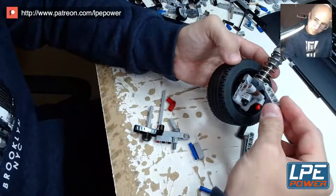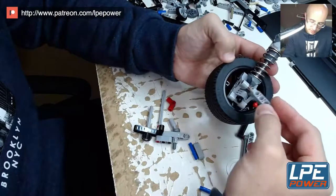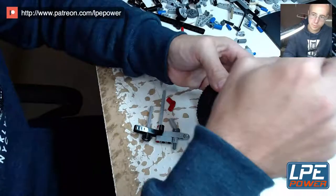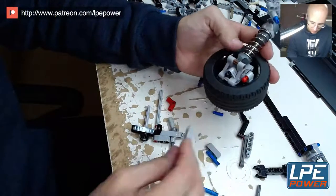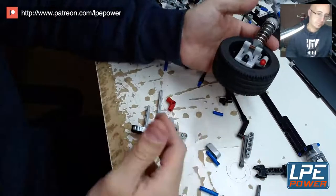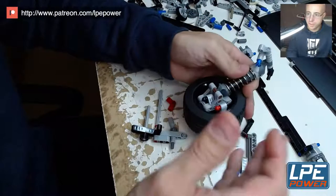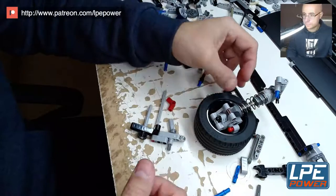Except then if we raise this, but then we destroy the whole concept of this simple wheel hub, and we have to raise this, which is gonna create problems on top. So it's not that simple, you know. It's simpler to have the anti-roll bar separate, live with slight inaccuracy in the suspension geometry, in the suspension layout, but I think we can all live with that. I hope so. I can.